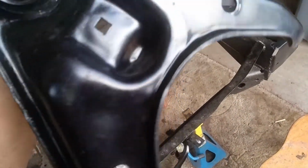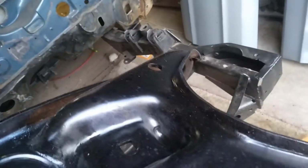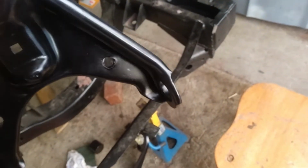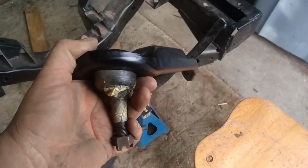Oh, that's the other thing. I was going to bloody prime those other front suspension parts after I put the converter on them too. But the weather's freaking turned to shit, and I didn't get a chance to paint it when it was a bit warmer. I put 2 or 3 coats of prime on there, but that's what the rust converter looks like after it's been sitting for a couple of 3 hours. At least they look lots better now, and I might have to give them a light scuff in the morning or tomorrow sometime, as long as the weather's good, and I'll prime them up and then hopefully get some black on them, and then see if I can get these bushes pushed back on them, and then I can put the top arms back on and put the new boots for the ball joints on them.